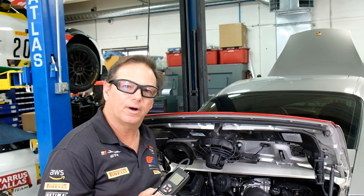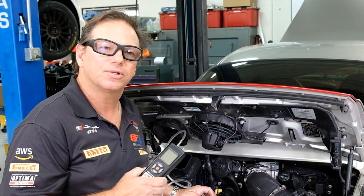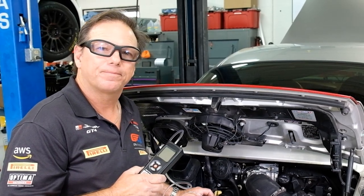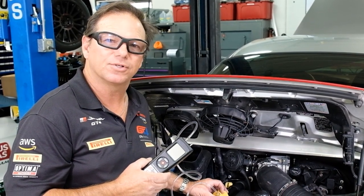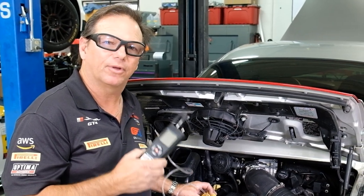It should be around four to six inches of water. Think about that — if one inch of mercury on a regular vacuum gauge is something like 12 to 13 inches of water, and you're looking for four to six inches of water, it's going to be very difficult to use a regular vacuum gauge.